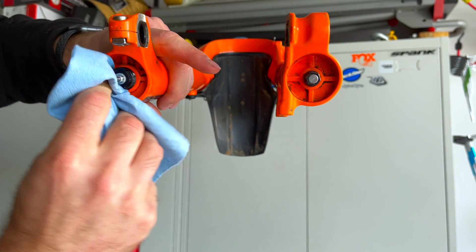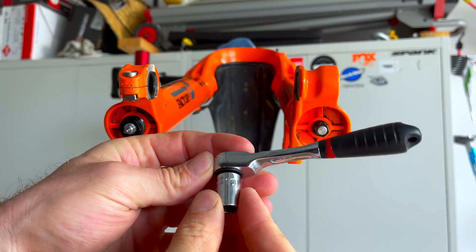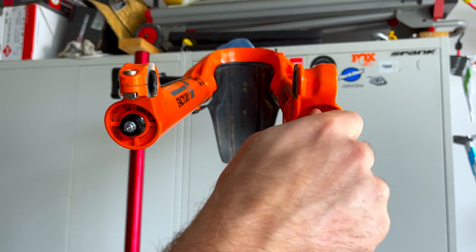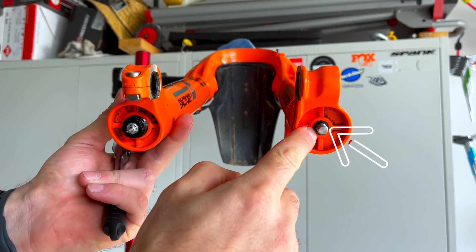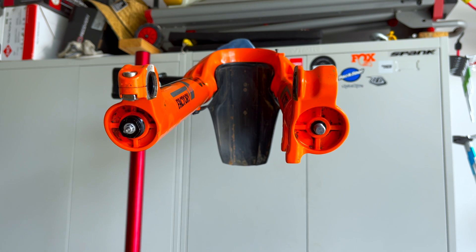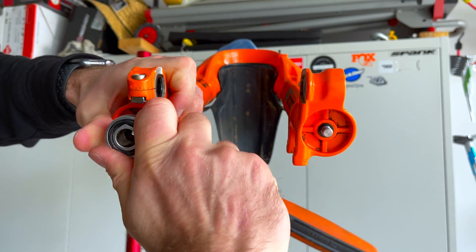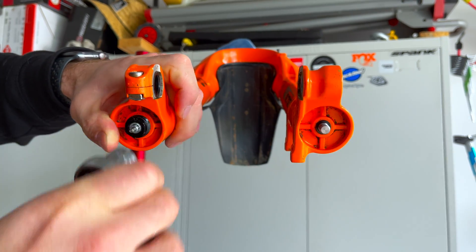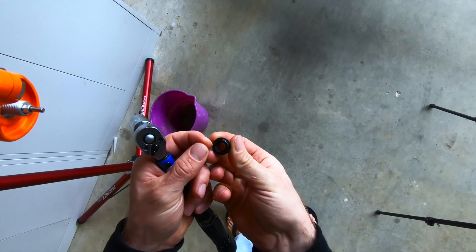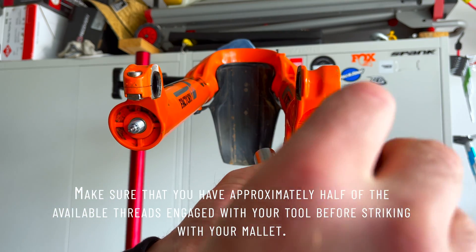Give everything a little bit of a clean. Now we've got a 10mm Allen for the air side — very gently loosen that off, then take it off by hand. You can see the crush washer is still on the air shaft, so I'll have to get that off later. Then we get a 15mm — put that on the end, be very gentle. Should just be able to loosen it exactly the same. You can see in the base there is a crush washer.